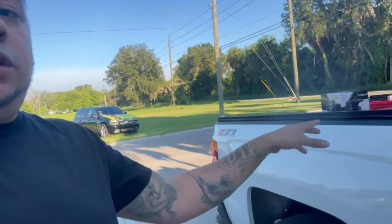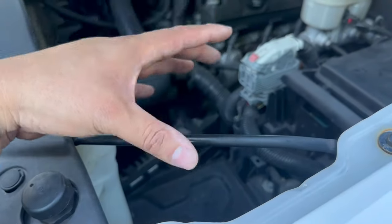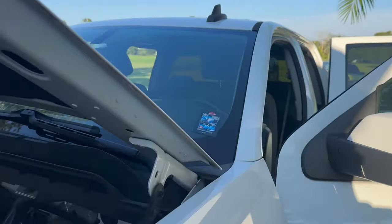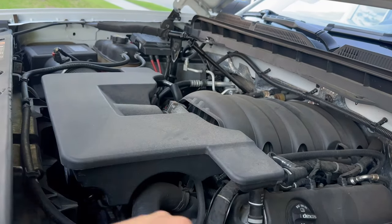If I just swap speakers out and build for the horns, I'd still need to put at least a 3000-watt amp in there. I'd also need more batteries — probably six more of those small batteries — and upgrade the alternator, change to an XS Battery, and add another XS battery in the location up front. The spare battery and the side batteries would all power the sub amp, and the new batteries would power the mids and highs amp. I'd run another gauge wire to the back batteries — power and ground from the alternator to the back batteries directly so this thing is a charging machine.